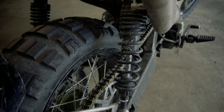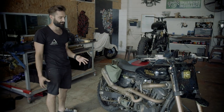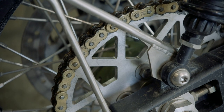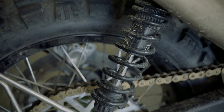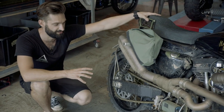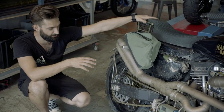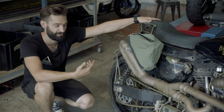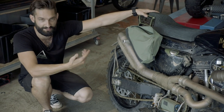Staying on the back of the bike, I used a Track Dynamics aluminium swing arm to shed a bit more weight. A big thing about this build was trying to remove as much weight as possible to make it more manageable off-road. Track Dynamics swing arm, aluminium sprocket from Moto Products, and aluminium crash bars that I've made up as well. KTEC suspension on the rear — I had those through my mate Joe at Ride Dynamics, who recommended them highly, and after the first test ride off-road they performed really well. With the suspension lifted up so much — these shocks are 14 and a half inches long — that created an odd run on the chain. So I've made a chain tensioner using a skateboard wheel donated from my mate Jake, fabricating it to run on a spring and operate as the rear suspension travels.